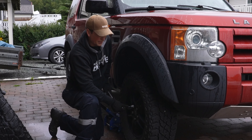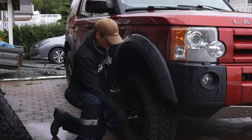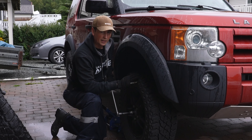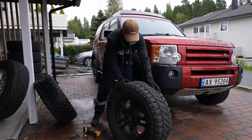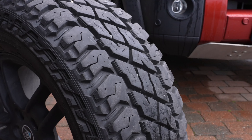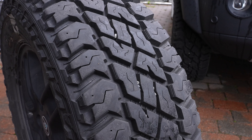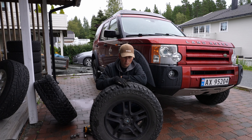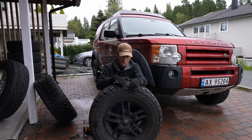For 4x4 tires or off-road tires — I'm thinking like A/T tires with big lugs — and hybrid tires like these, you can experience stepping. So if you take a look at my tire, this is a hybrid tire which is basically mud terrain on the sides and all terrain in the middle. You can see the big lugs on the side. Stepping is basically that you get low one, high one, low one, high one — different heights — that's why we call it stepping: step down, step up, step down.